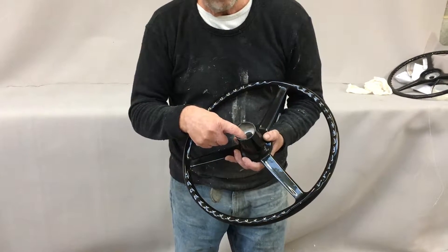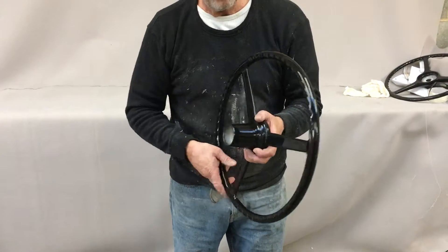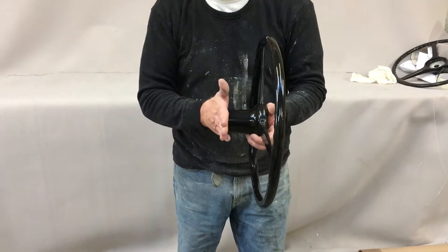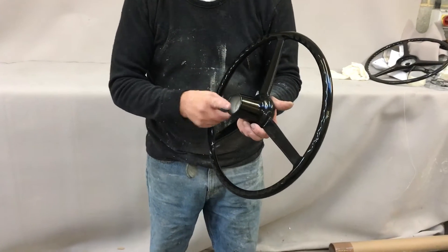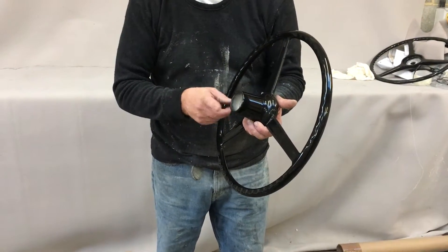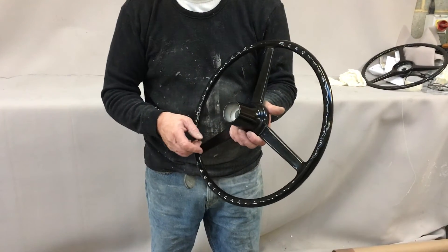These columns are more popular among replica builders. We also do it with an E-Type boss with a tapered seat — we get 48 splines — or, like this one, the XJ6 Series 2, 3, and S with 36 teeth with a three-quarter spline.